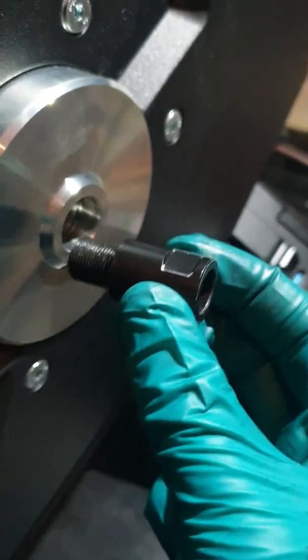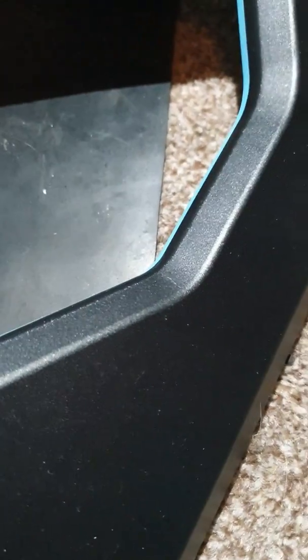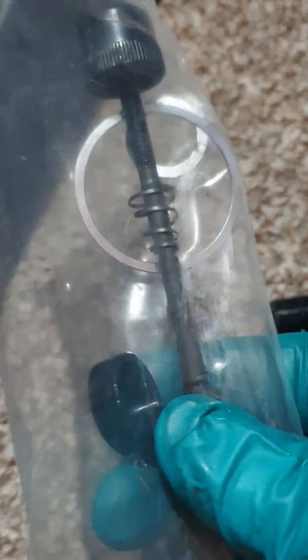I've just removed the adapter — it was obviously way too short, not anywhere close. If you look within your kits that you get from Tacx, this is one of the Tacx complete kits. You'll see a small black spacer — there, a black one, it's the only black one in the pack. The two others are just silver shims. I'll not take it out because I've already got one out, which is this 5mm spacer.